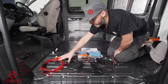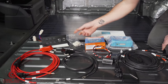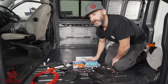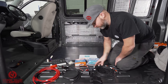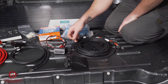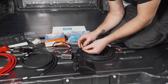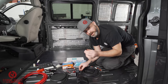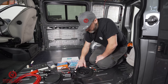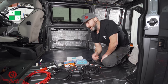To carry on with the battery, we have the wiring that will connect from your battery to your split charge system, and from your vehicle battery into your smart charger, from your smart charger to your leisure battery. And to finally finish off, down in this corner we have all the wiring for your solar panel. They've gone to the lengths of pre-slicing the ends of the cables so you can whip the ends off, then terminate them using the provided plugs. They're all labeled as well — solar controller positive in, solar controller negative in. It's all very good gear, all pre-terminated.